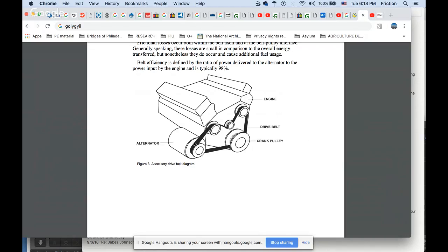Now, if you plan on running auxiliary headlights, extra headlights, when I say auxiliary, then you want to see if your car addresses that. If your car's manual says, you know what, you can add extra lights with this package, with the alternator that's existing. But sometimes when they upgrade a package, an electronics package, if you will, like extra headlights and all this craziness, the generator will get upsized. So you just can't add lights, you just can't do whatever you want to with your vehicle. You've got to know its range.